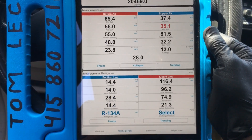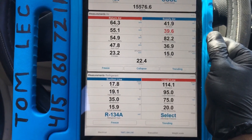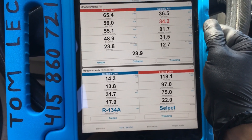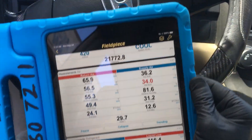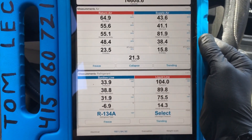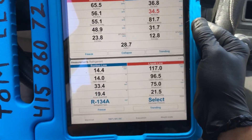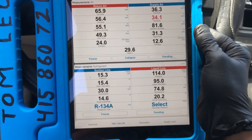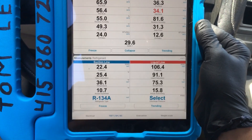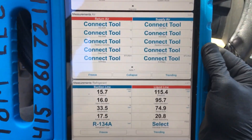Wouldn't that be considered abnormal? If I was using a can of AC Pro right now, their little green range goes from about 25 PSI to 45 or 50 PSI. So 14 PSI would look a little low — meaning you'd just keep filling until it hits 25, 35, or 45 PSI, and according to AC Pro that would be considered good. That's enough said about using AC Pro. I've got an incoming call, so I'll see you guys later.